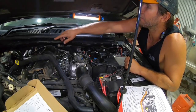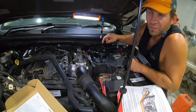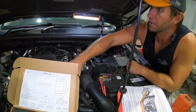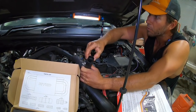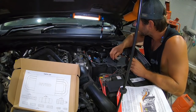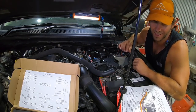So I've managed to get the first hose on the PCV, and that means if you read the instructions, follow it around, it goes to the bottom fitting on your crankcase ventilation filter. So they're big ends on this end, so they run some big hose clamps. Put one of those on and then slide him on to the bottom fitting on your crankcase here. Do the clamp up and then we'll chuck this one here back on top, eh? We're just about done. Yes.